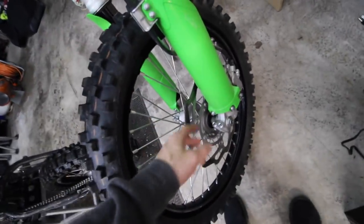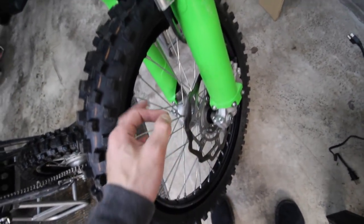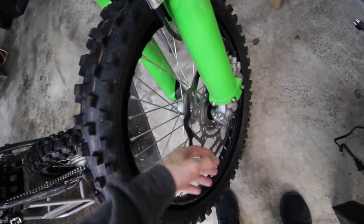I'm going to take the front wheel off, take the front pads out, get some sandpaper, scuff them up a little bit. Maybe that'll help. If not, I'm going to have to buy new brake pads, contact clean the rotor, and hopefully that should do it. But that's it for the 250. For the pit bike, as you guys saw, this thing is smoking super bad.